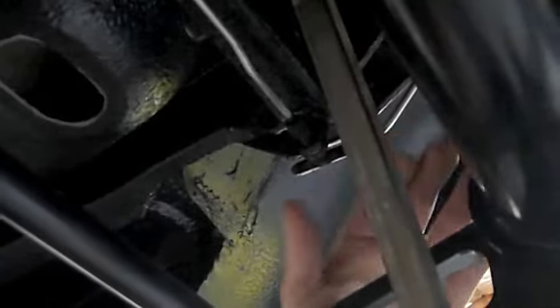All the brake lines are basically in. As you can see, we use our line holders — a plastic insert that goes in a quarter-inch hole and holds the line. If you ever need to take it out, you can. It holds it away from the chassis and keeps the vibration down. Moving up, you'll see it go over the rear end — it has bump stops on the shocks so it'll never come up there. The hose connection point goes out to the caliper, then we cut it back across to the other side. Always try to keep brake lines away from anything that's a driveshaft or anything that could possibly break and cut the line — run it behind the rear end so it's not susceptible to any rotating assembly.